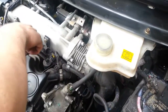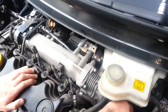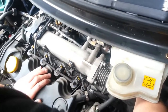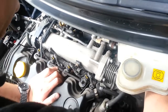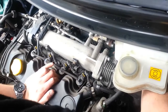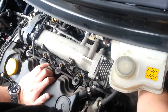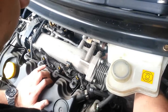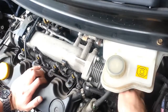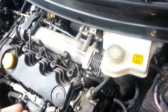If you follow the injector pipes back, you can see that they will lead to the rail. Place your hand around the back of the block and see if you can feel the rail — it's a long cylindrical tube along the back of the engine. If you can see that there is no rail pressure sensor in the centre of the rail, move to the end and see if it's present at that end of the fuel pressure rail.